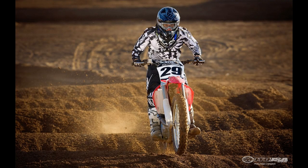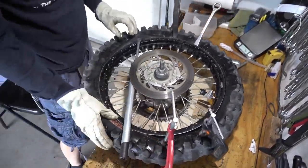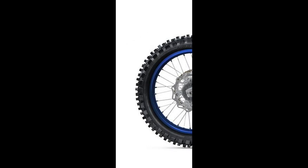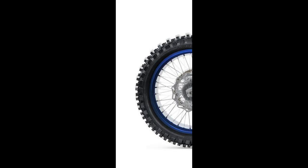On a 19-inch, the tire installation is a little bit harder, usually caused by the fact that the sidewall of a 19-inch tire is a half an inch not as wide as an 18-inch. Because the rim is larger and the tire size usually stays the same, the wall of the tire is actually smaller. If the tire wall is smaller, it's harder to install.